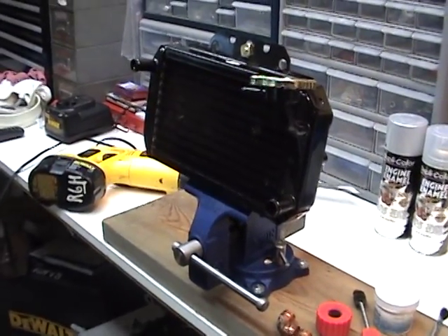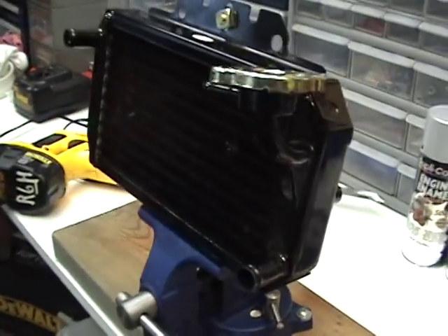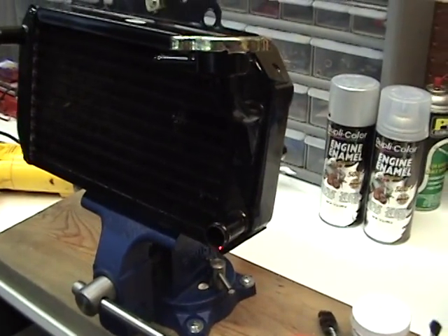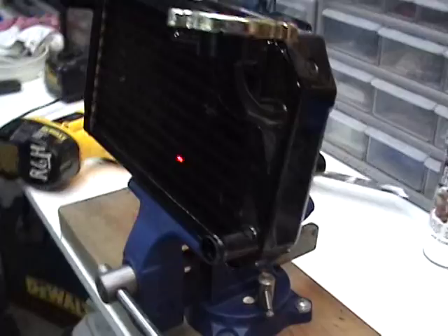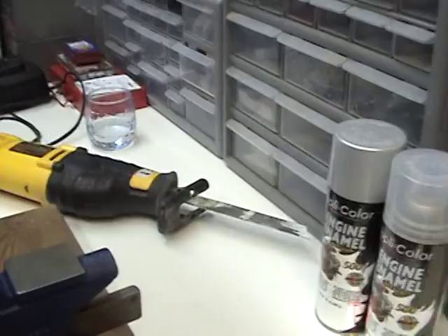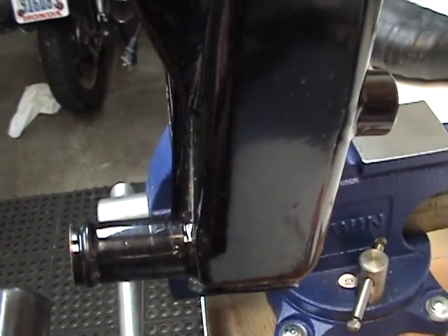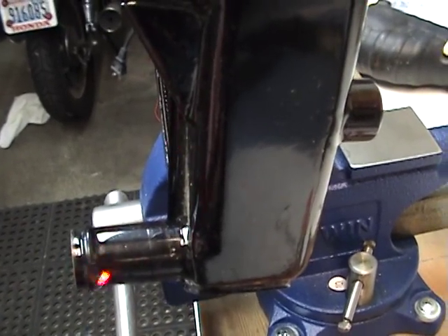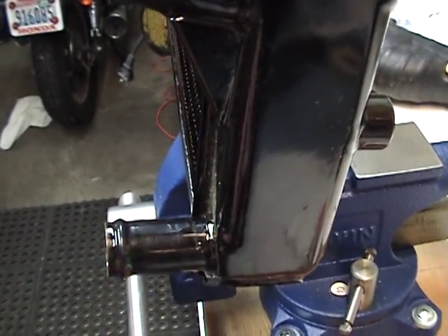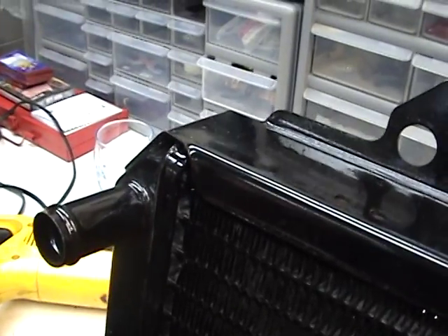Continuing in the series to modify the radiator here. I'm going to take this area right here where you see the little nubs. I'm going to take my little Dremel — it's kind of a big Dremel — and I'm going to cut right here. Then what I'll do is take some sandpaper and clean this up really well on both sides, the intake which is right here.